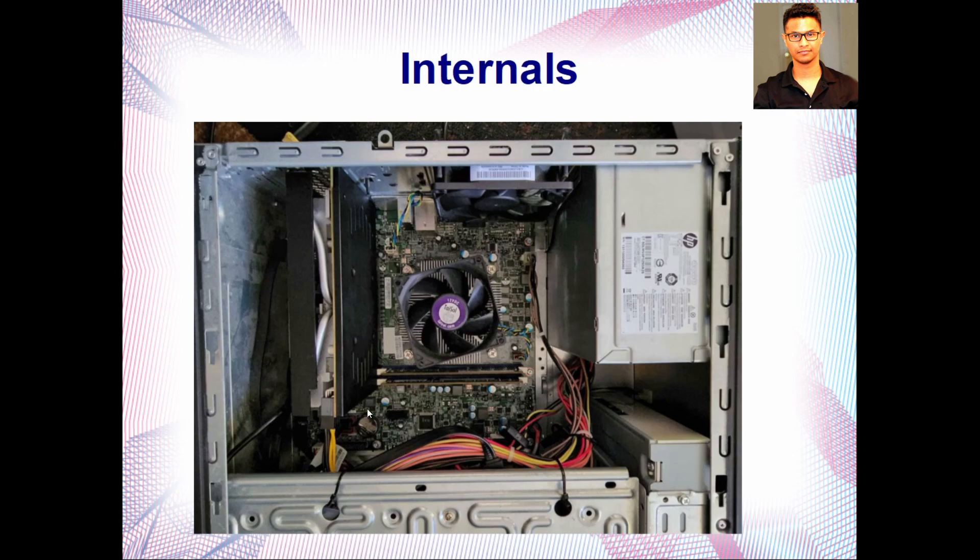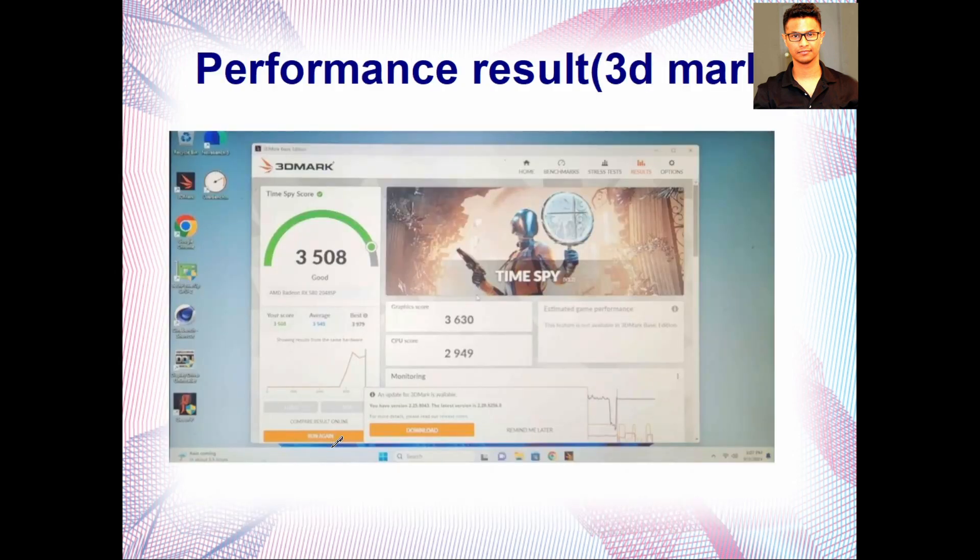Here's what the internal build looks like. I didn't have two 8 GB sticks — I had one 8 GB and one 4 GB, so I achieved dual channel with 12 GB total. I was able to fit the RX 580 2048, which is a pretty small GPU, and I got away with just a 350W power supply using a PCIe 6-pin SATA to PCIe 6-pin cable.